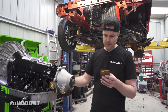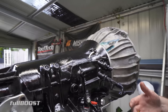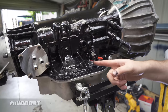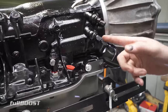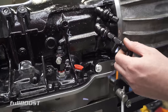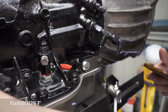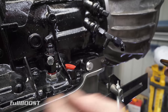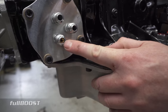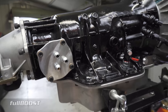It's got a Hughes pro series two-stage torque converter dump valve. Over this side there's a lot of very different stuff compared to a normal Turbo 400. Normally this governor plate area wouldn't have anything on it, and this would just be your normal transmission cooler outlet line. What we've got is a dump valve system - this runs to one dump valve, this to another, these two to another dump valve, and then these are now your cooler lines. Inside the cooler line there's also a restrictor - like a little jet - and that's how they tune the pressure of the whole system.